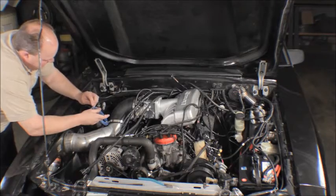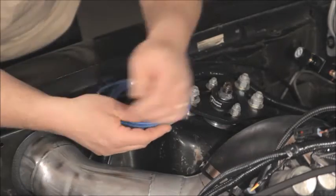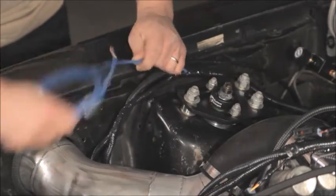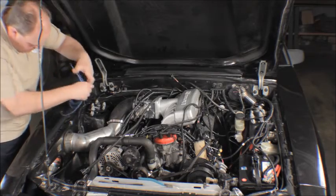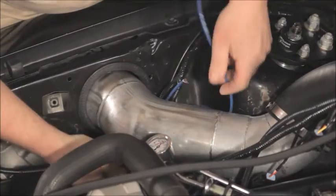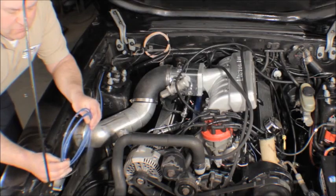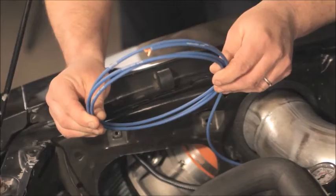This lead is for an electric cooling fan. The wiring and relay are already in the new harness, and they are heavy enough to run two very large fans. If you're using an electric fan, you really should use this wire. Disconnect and remove whatever you are using for the fans now, and connect this wire instead. The Pro-M EFI processor handles all of this for you and does it the right way.